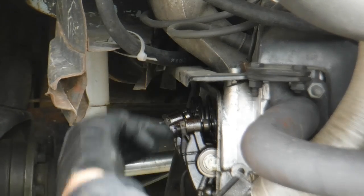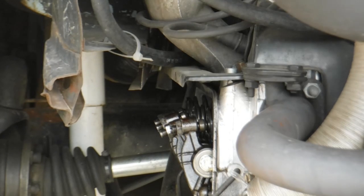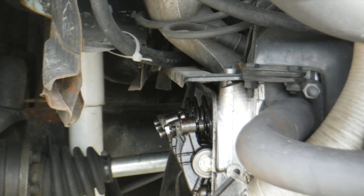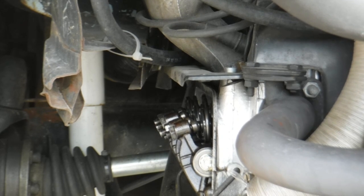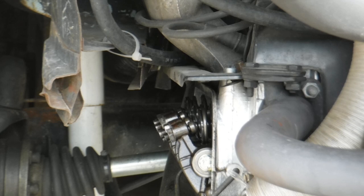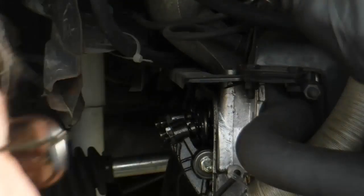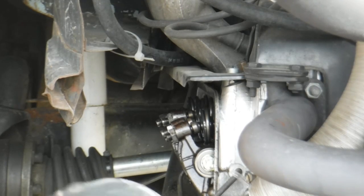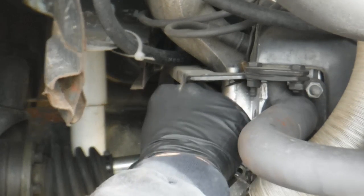Helps if you're ambidextrous and do a little yoga! Exhaust on three is good - that's incredible. I did adjust them when I was in Michigan. I wanted to check them because we had just changed these heads, and a lot of times the first thousand miles they need attention, but as I recall they didn't really need it then either. Now I'm turning it counterclockwise and we'll check the last cylinder, number four.